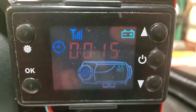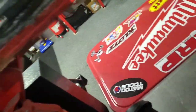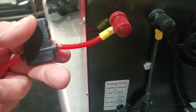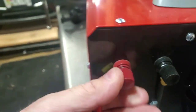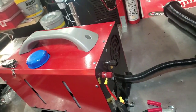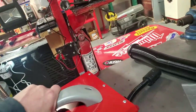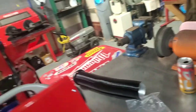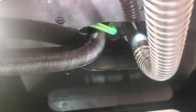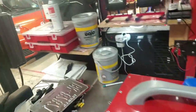I thought these things are cool as hell — I mean how much easier can you get? I'll just let that battery charge overnight. On this unit you've got your own terminals — I'd run a fuse back here and then use decent-sized cables. Don't use speaker wire; use 12-gauge or bigger. Underneath you just have your exhaust port and your cold air intake. That's all there is to it.